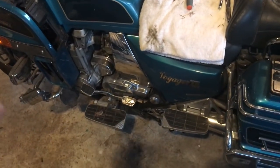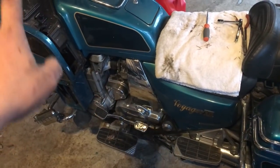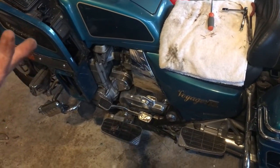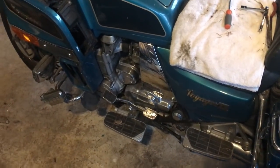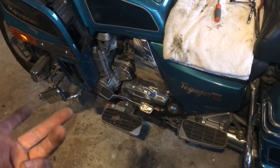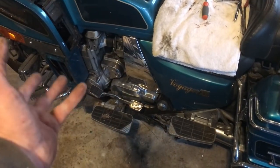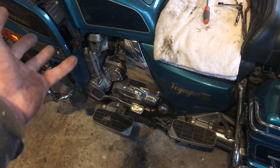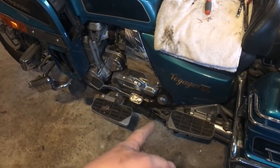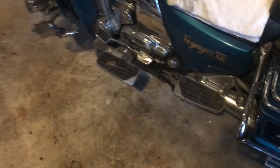So a real mechanic looked at this and told the guy it had bad spark plug wires. They did not. The spark plug wires were not bad, but they were pulled apart. I don't know why or how that happened, but I put them back together, and it turned out the issue with no spark was a bad sensor. He was saying he couldn't get it to start. The guy said it was bad spark plugs and wires. No, it was the little sensor for your kickstand. That was the only issue. It just needed to be cleaned out. It had a bunch of stuff in it.